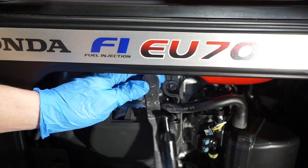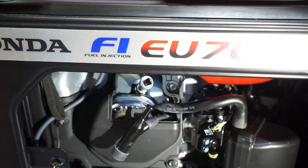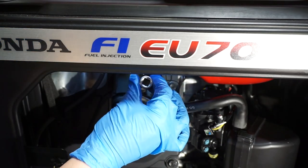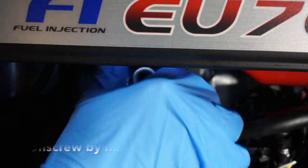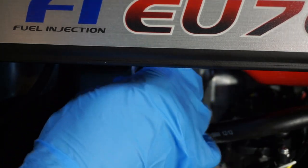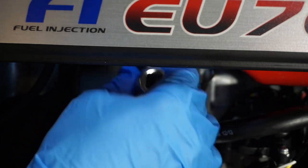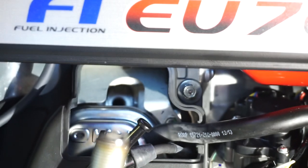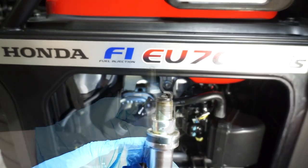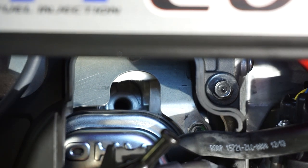That's out. Once it's loose, I pull the ratchet off and twist the extension by hand — doing it by hand means I won't damage anything. Keep going until it's quite loose. If you're using a spark plug socket, once you take the plug out it should come out with the plug on the end of your socket. Now you can see the spark plug hole right there.